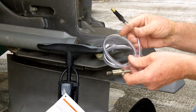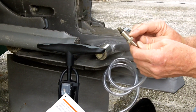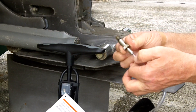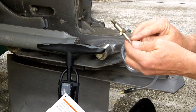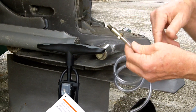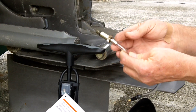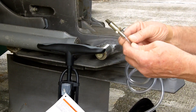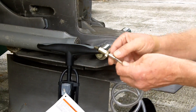Here is my adapter — this is off my gear oil pump. The line is a quarter inch, three-eighths outside diameter, quarter inch inside diameter. I took it off, and a lot of times to get these barb fittings off, you have to actually cut the tube and then take a knife and slice it. That's what I had to do with the one on my oil pump — cut it off and slice it, and it peeled right off.